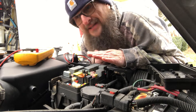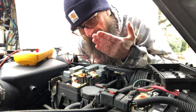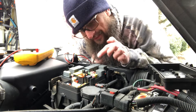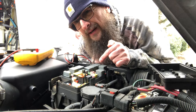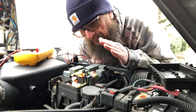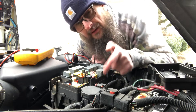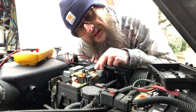Typically, you would have a fuse box in an older car that's wired right to the battery. Everything on one side would be hot, everything on the other side would be hot through the fuse. But this is a little integrated power module. The way this works is the switch inside sends a signal to the TIPM, and the TIPM turns on these fuses.